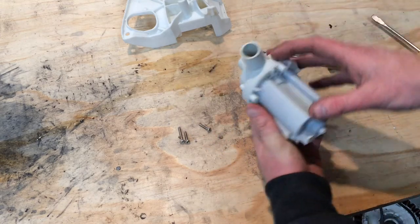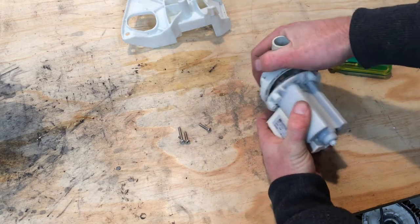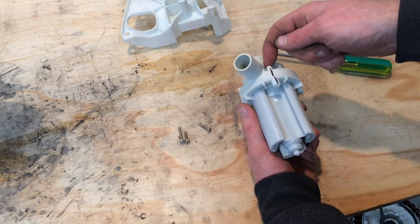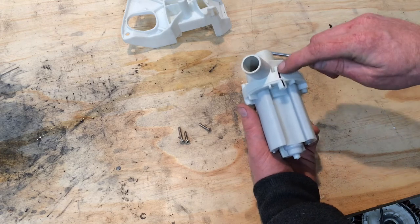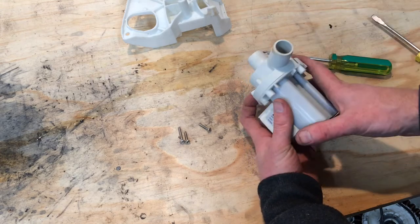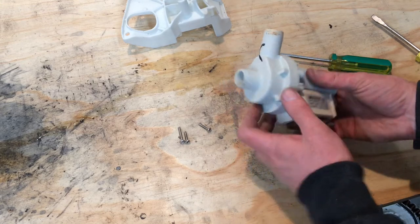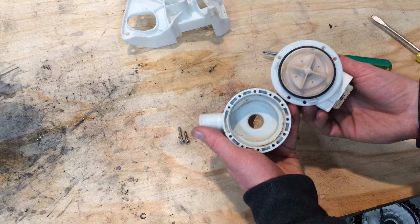The position of this drain pump housing is quite important because you also want that spigot coming out the same way, and it can sit in a few different positions. So you can just remember the top hole goes through into the screw hole which is right close to the outlet spigot, or you can do what I've done here — just put a permanent marker on there to mark it and show you which way when you put it back together. Once you've got those five screws out, this just pops open.